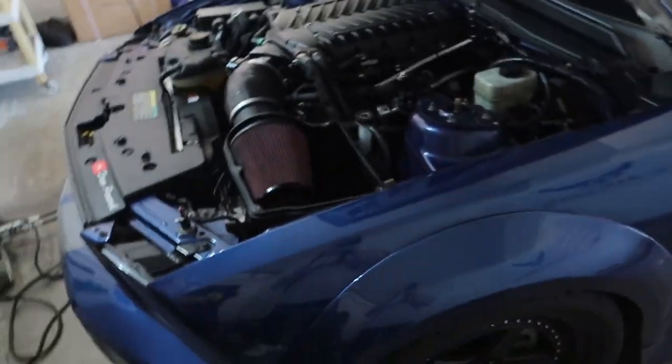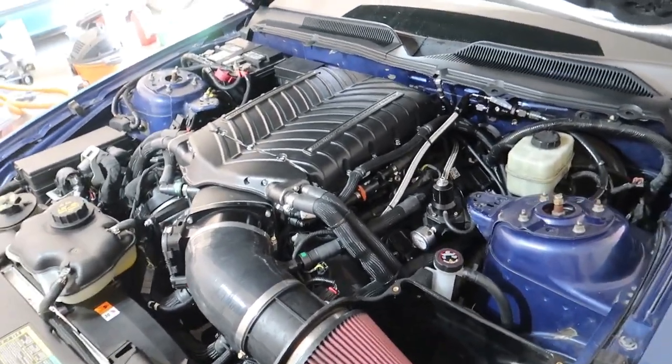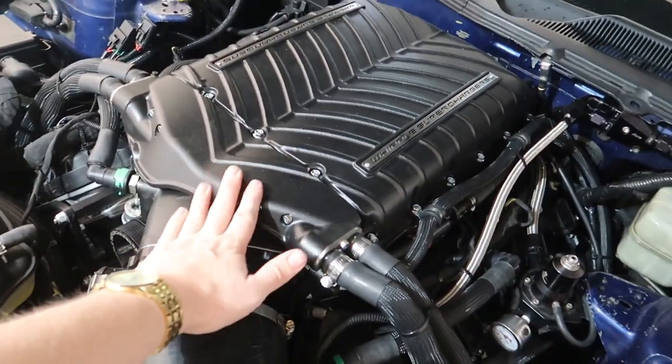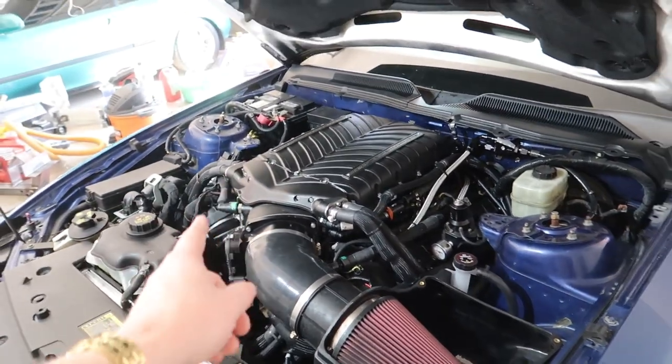I'm joking — let me prop up this hood. So if you remember, the supercharger seized up and I thought the motor was blown. I started the car without the supercharger belt and it fired right up, so I knew the supercharger was the problem. I took the blower in and got it warrantied out. It's still the Whipple Gen 5 3-liter on top with the same pulley, but that got me a little worried.